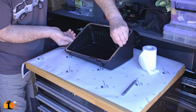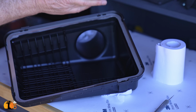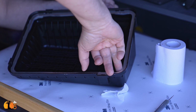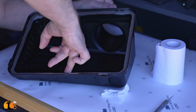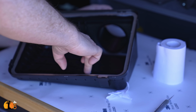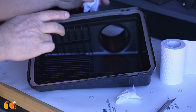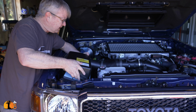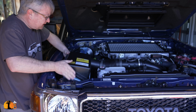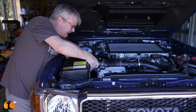And if you put silicone on, this actually looks like a stainless steel, so it wouldn't apply in this case. But if you use silicone on steel, it causes it to rust very, very rapidly because it's acidic. I've seen some conversions done to cars, and they've used silicone to bond on steel. A really bad idea, because it just rusts. So the suggestion is you put it back and you let it cure in place, because by letting it cure in place, you're basically clamping it with the forces that you'll end up with. So put this back in here.